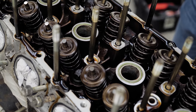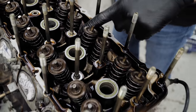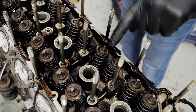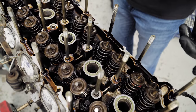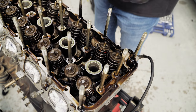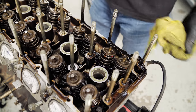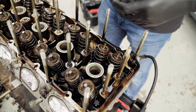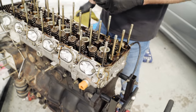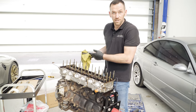So this gives us access to the head bolts now, which you can see here. You've got your valve springs, top of the valve here. Your valve stem seals, which I know you've mentioned. Yeah, I want to do the valve stem seals, because they're basically hidden inside the valve springs there. So you have to strip the head out, remove the valves, replace the seals. We'll decoke the back of the valves, lap them back in. And that'll give it a sort of factory fresh feel. Yeah, I think that's kind of where I want to go.